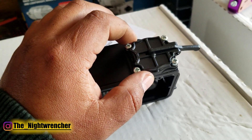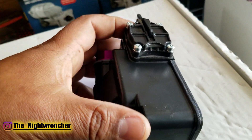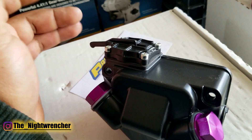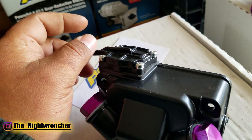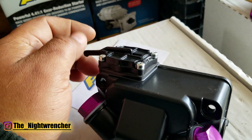Looking at the bottom of the fuel bowl, you can see the cover for the accelerator pump. This is a 30cc accelerator pump. There are aftermarket options to upgrade it to a 50cc, and the bolt pattern is essentially the same, so if you needed that extra fuel, you could get it. You can also buy upgraded fuel squirters, or in my case, I just end up drilling them out — I'll show you guys how to do that in later videos.